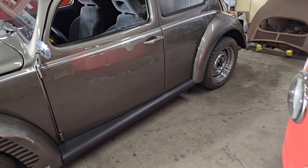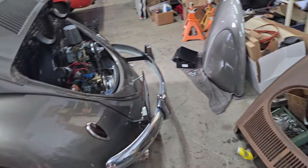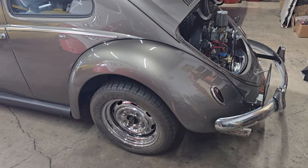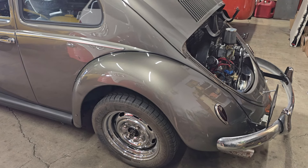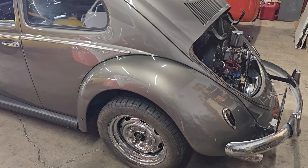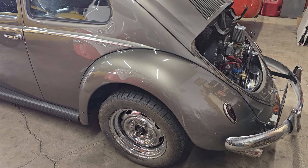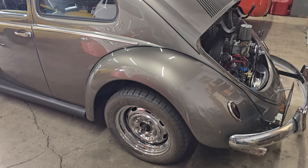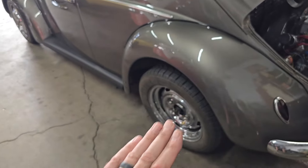A few things at the back of the car. Yesterday I hadn't put the drums on yet, so this morning I went ahead and put the drums on, got them all torqued down, added transmission oil to the transmission — lost quite a bit since I had to replace the rear axle seals. Usually a decent amount leaks out when you pull those all apart, especially with the car up in the air and the axles tilted downhill.